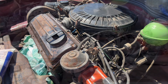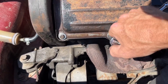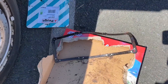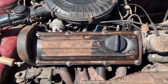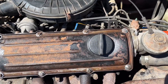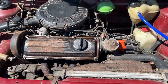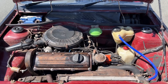Start putting them in. So there you have it - little bit of a clean up. All you gotta do is just nip them up, you don't want to crush the new gasket. That's it, all nice and clean. There's the old one and the new one. Cost £5.25 delivered from eBay - easy fix. Bit of cleaning up, the job took about 20 minutes start to finish. Cleaning inside and out the rocker cover, fitting the gasket - job's good on. Thanks for watching, more on this 1984 Mark 2 Polo bread van coming up, cheers.